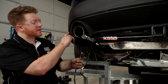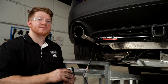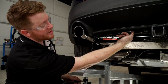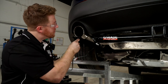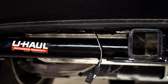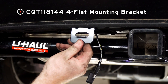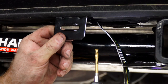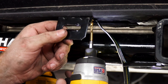With our wiring all powered up, we're ready to mount our four-flat. We'll route it towards our hitch following the same route as our passenger side T-connector and bring it out of the opening in the center underbody panel. We'll mount our four-flat using a four-flat mounting bracket — this is not included with our kit, so you can pick it up at your closest U-Haul. We'll drill two holes using a 3/16 drill bit.